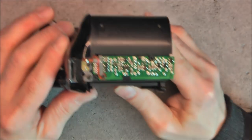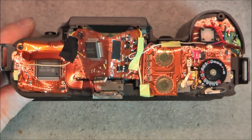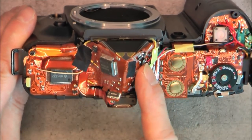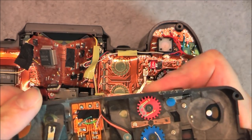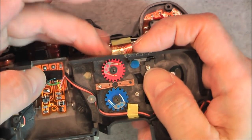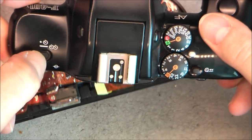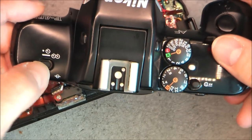All the gears here on the side, and here the flash circuit board it seems. If I remove the top there are a lot more electronics with big ICs. It is very common to find a folded piece of flat flex above the prism assembly. There is a nice design of contact pads for the top rotary selectors, which are secured — you have to press this and then you can turn. There is a little copper spring, quite interesting, plus a bit of flat flex for the flash socket and a push button for the timer with a brown circuit board and a rubber carbon contact.